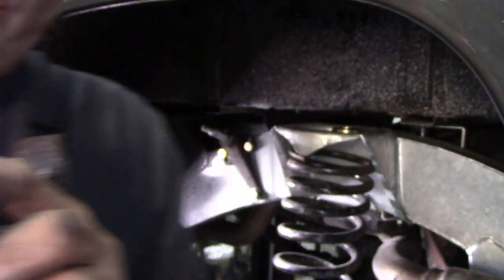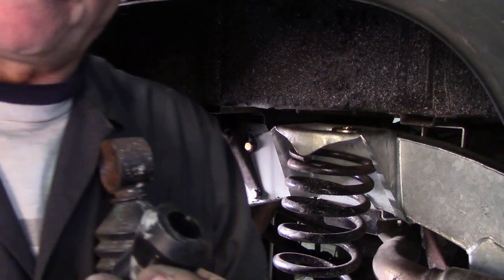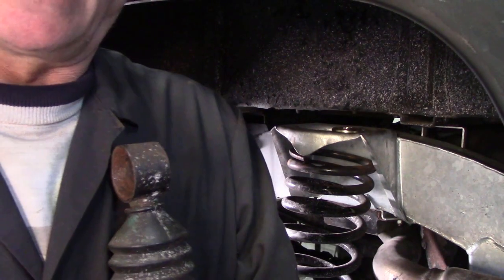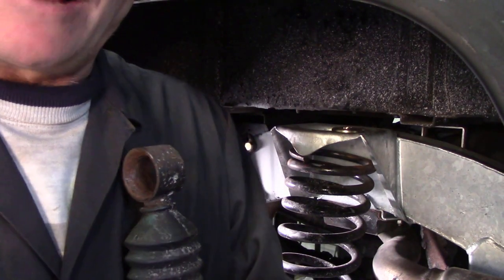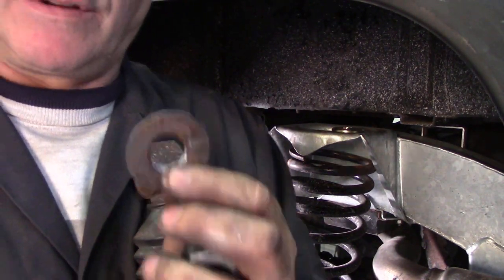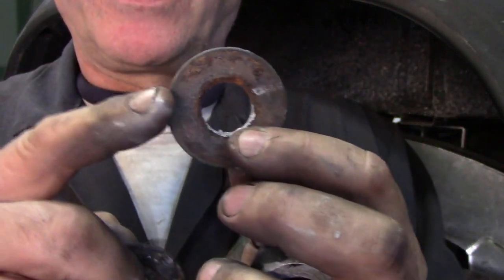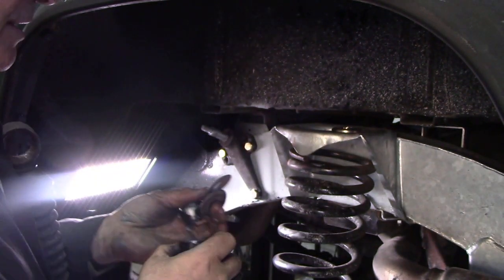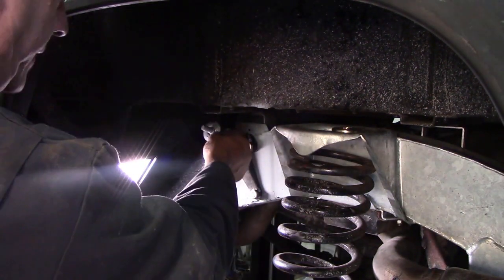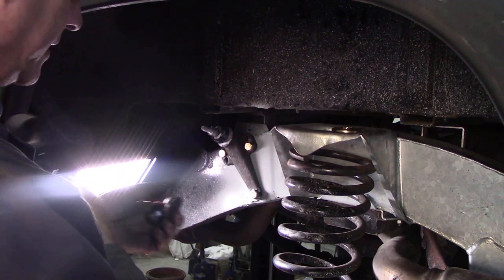I know that these are old style, because some have a solid bush with a pin in. They seize up, but these are quite easy to get out. One word of warning — different sizes. This one goes on the inside, this one goes on the outside. So we put this one on. I always put plenty of anti-seize on anything now — anything that moves, I anti-seize it.